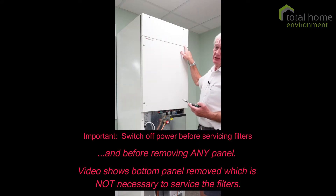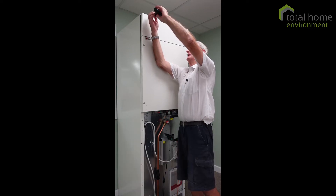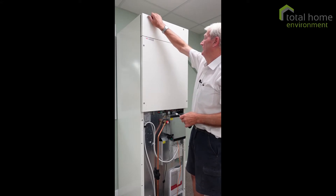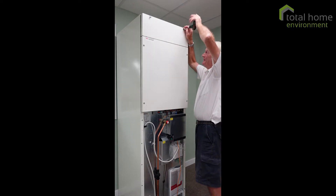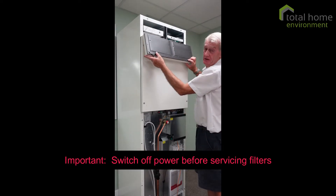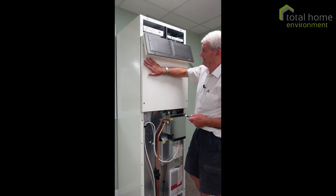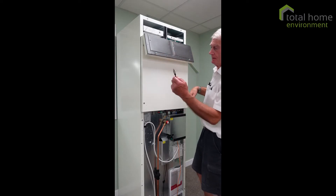The filter compartment is above the piano hinge on the front panel and we need to unscrew it with an Allen key. On earlier models the screws at the top were actually just slotted screws and there were quarter-turn catches, but there was a problem with that because occasionally air would escape. You'll see there's a foam pad here which is a closed cell material, and over time when the front cover had been on and off a few times that became compressed and you'd get an air leak. So on the later ones it's a set screw with an Allen key head.